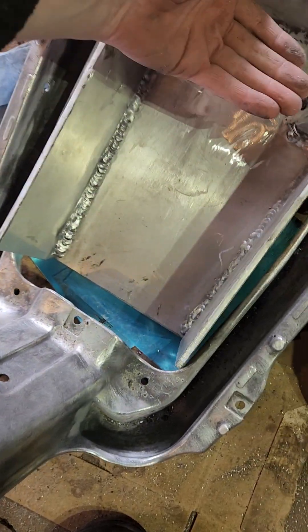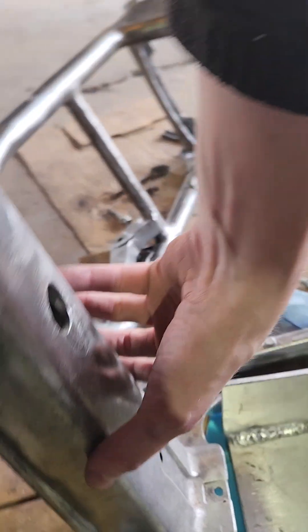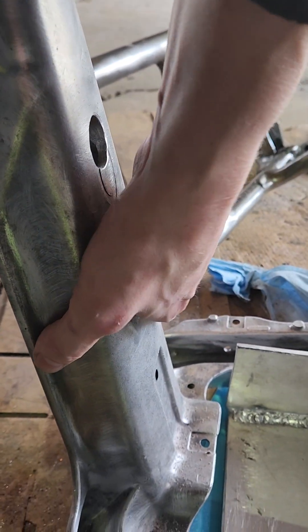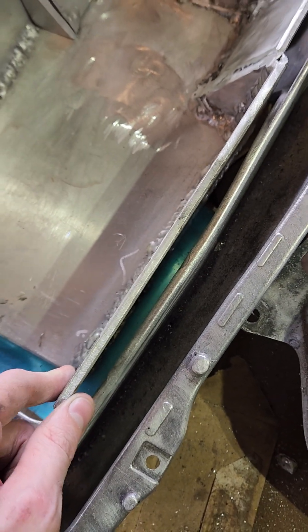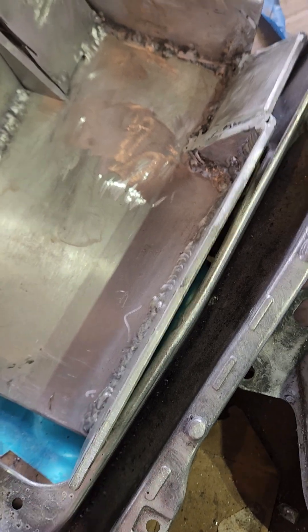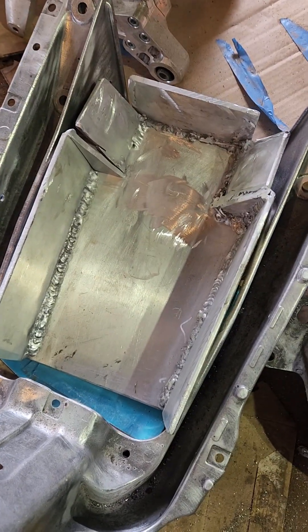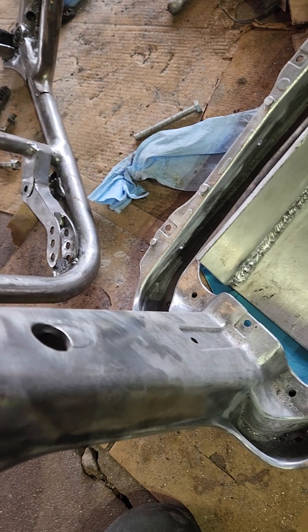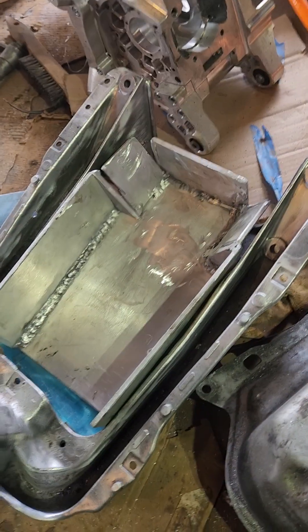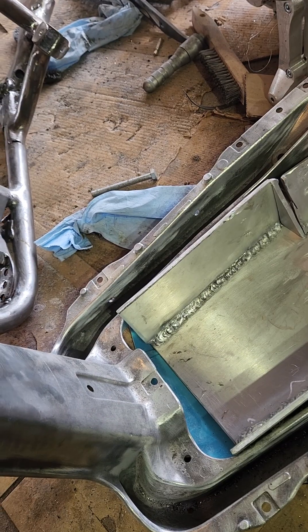It's going to slope down from here up to here, and I plan to have it wrap around the neck and actually bolt into the neck. That's why I made it out of quarter-inch aluminum — you could probably do one-sixteenth inch and it'd be fine — but I wanted extra support. If I make the gas tank extremely rigid and bolt it to the cast section of the frame, it might give me a little extra structural stability.